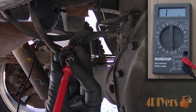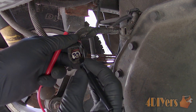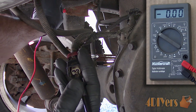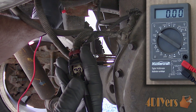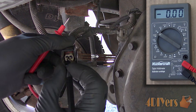You can also test the resistance on each of the wires between the ABS module and the speed sensor plug to check continuity between the two plugs. Next, reconnect the ABS module plug, then turn the key to the run position with the engine off. Again using a sufficient ground source, probe each of the terminals on the speed sensor plug. There should be no voltage present — if there is, that means there is a fault somewhere in the wiring or module.